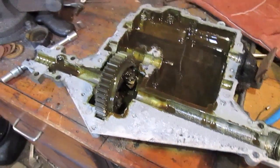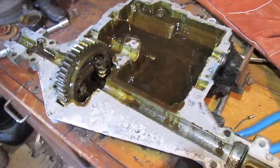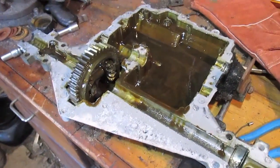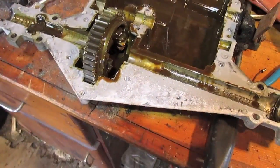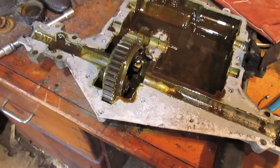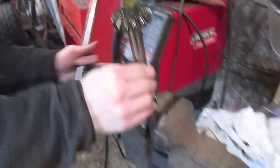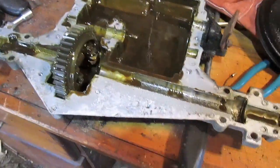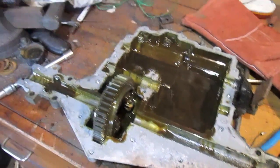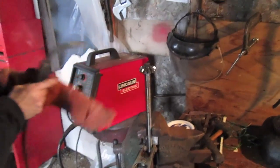So we've got the Transaxle part now, and I'm pretty excited because I figured out that the Transaxle is an MST205, which is the same thing that Fearless has got in his Murray, and it's oil filled, so it's a lot more heavy duty than just a grease filled one. We've got this opened up, and we'll start welding up the ends where there's C-clips, and then we'll weld our spider gear in there and put it back together. I've got welding gloves now that I can actually wear.